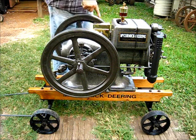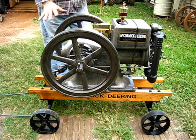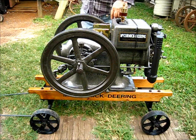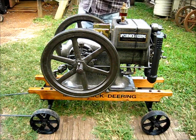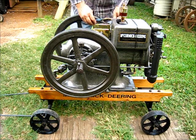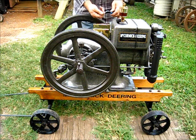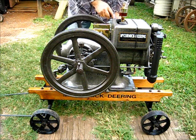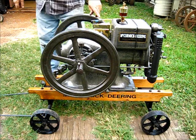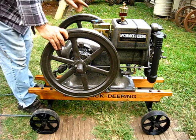The magneto is now installed. To test it on the engine to see if we got a spark, I could remove the spark plug, put the spark plug wire here, and test it that way. But a real quick easy visual test is this: the light right here — put that right up there. This is a metal thing sticking down right there and I can bend this to sufficiently give a spring action that grounds it out, and right in there is where we will see the spark. The lever is actually down on the run position now — you see a spark?